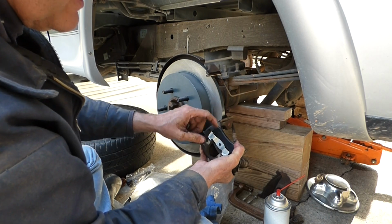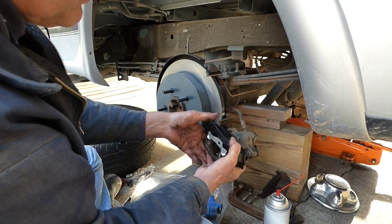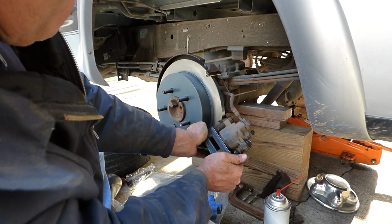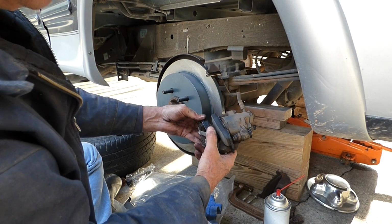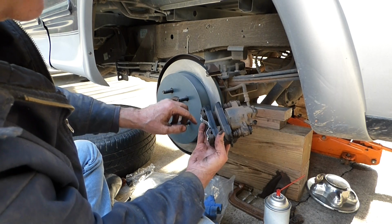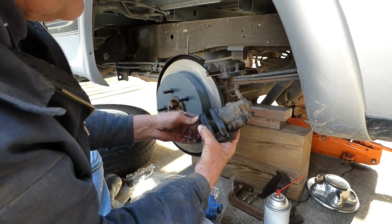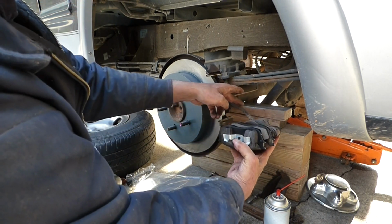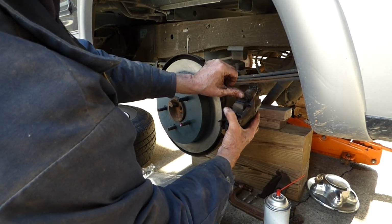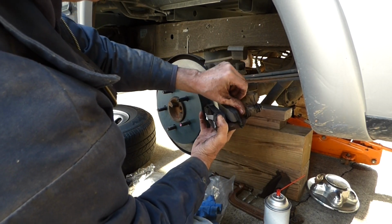There's a little nub on the back here on each side, and that nub has to go in that hole. You want to make sure that's sitting flush against the plate. There we go. And that's sitting nice and flush. See how that's nice and flush there? If it's not, kind of lift up on these, press back down. Again, make sure your hose isn't kinked. Push your guide pins back so you can fit that in there. Push those guide pins back. Otherwise you get caught up.